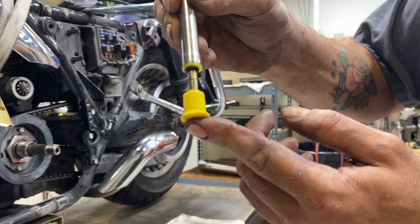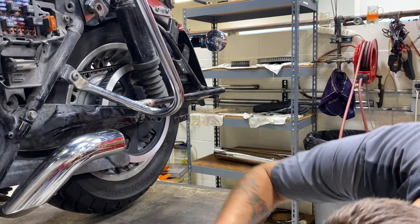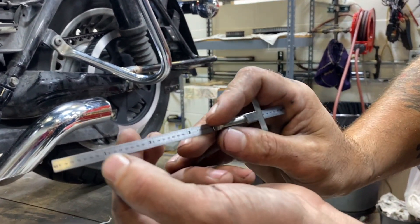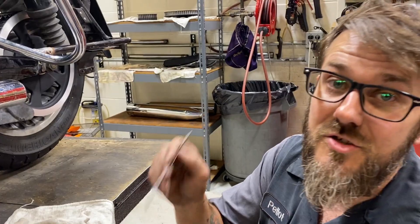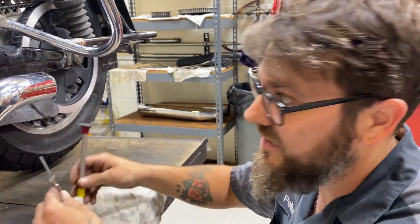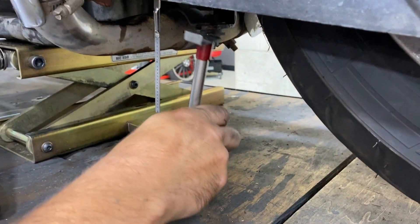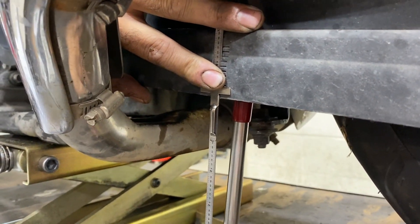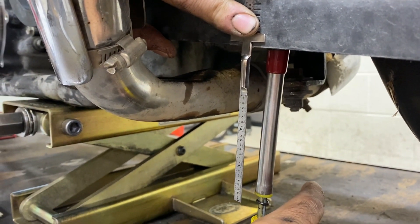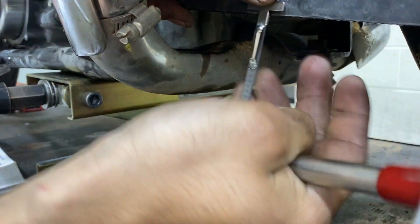We measure 10 pounds of force with this belt deflection gauge — there's a little line on there, and when I push it up and my o-ring hits that line, that's 10 pounds of force. Comparing that with my ruler, all these graduations are sixteenth-of-an-inch increments — technically sixty-fourths, but I won't get that precise. I hold my ruler here, hold my deflection gauge with no pressure, get it lined up so I can see the very bottom of my gauge on my ruler, and as I press up to 10 pounds it reaches just at three-eighths of an inch.